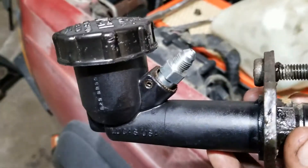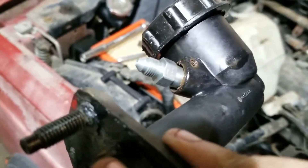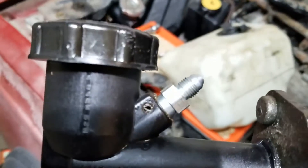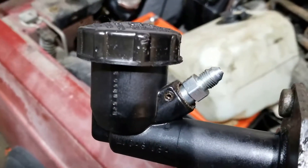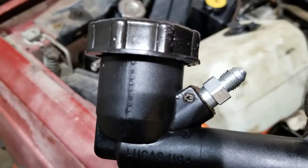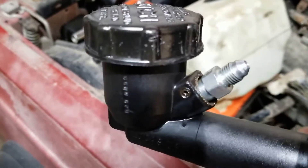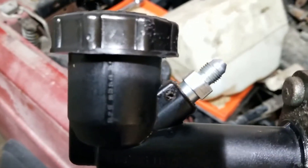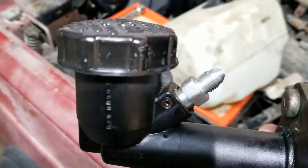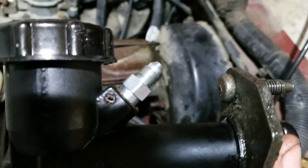I got the new fitting in here. I had to drill mine out a little bit to get it to fit at the top, because the top of the new fitting was a different size from the original. So I'm not going to leave the link to this specific part in the description - you can do a little more research to find a fitting that fits a little bit better. I know there are fittings out there that fit just like the Jeep one does, or you can even tap this out to screw it in. Anyways, I've got my piece in here with AN3 threads on the end of it. I'm going to wrap the threads with some petroleum grade Teflon tape to make sure it doesn't leak, and then we'll reinstall this right back where it went after we hook the new hose line onto it.